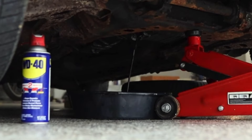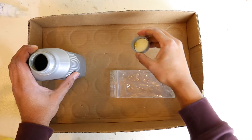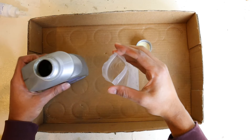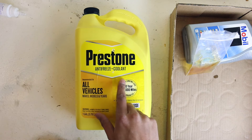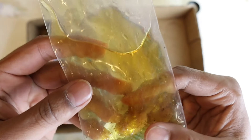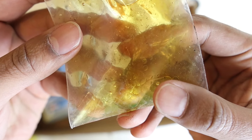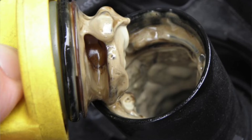The first way is to simply check the oil — take the oil out, take the filter out and check it. I put a little demonstration together where I'm mixing coolant with oil. If you remember back to middle school, water doesn't mix with oil. When water and oil don't mix, they separate. But when water meets engine oil and it's heated up, it turns into a white grayish substance that is very clearly not just oil.